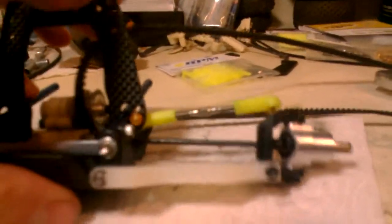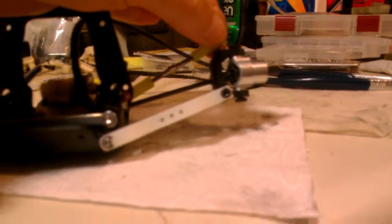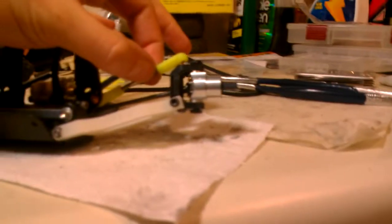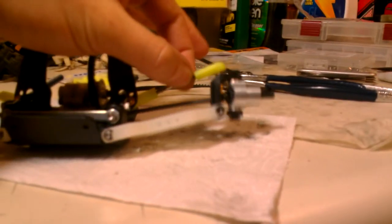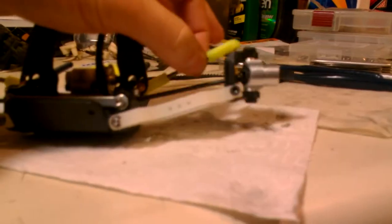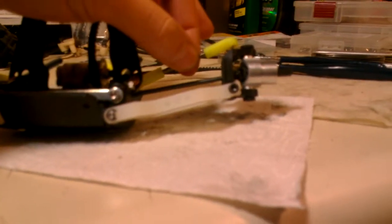So I'm basically opting to use the lower hole, and I'm basically going to bet that I won't need this much suspension travel, because if you think about where the nose is here, and then as I compress the arm all the way, that's where it fully binds, okay? So with a 2.2-inch wheel on that axle, chances are the nose will be bottomed out by the time this dog bone hits the ball cup here. So, just put some up travel limiters in the shocks to hold this back a bit, and you should be okay. So that's the way I'm kind of forced to do this in a sense.